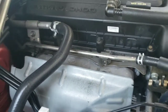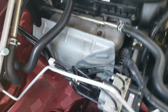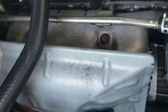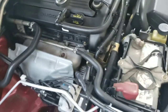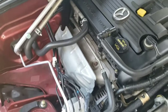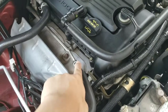Hopefully that gives it enough room to move out of the way. There's also a heat shield right here — I can see where it bolts on there, and feeling underneath there's some stuff there too — one bolt right there and one right there. That might be difficult to get to unless you remove your wheel and tire. Once that heat shield is out of the way, there's another heat shield right there where it says 'hot' that will also need to be removed to get to the header. I'm hoping I won't really have to move the ABS lines. I'll probably look at a couple of videos, but I'm going to disconnect the battery and remove this coolant pipe and try to remove the heat shields for now.